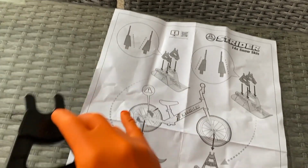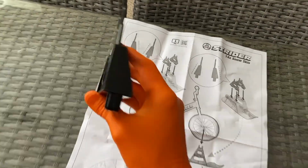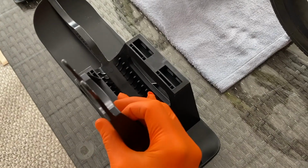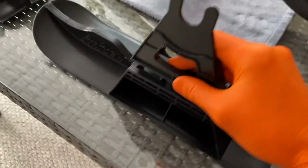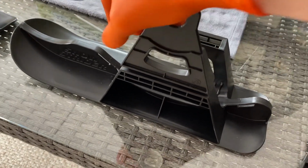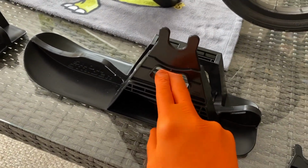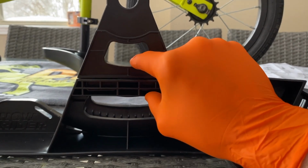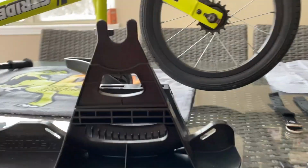And for the rear ski shown here, these plastic parts must be installed inward and facing the center, or closest to the center of the ski. And all these do is snap right into place. What I recommend is putting your fingers here and pushing until they are flush. As shown here, I had to set the camera down because this part was pretty stubborn. You have to give it some muscle.